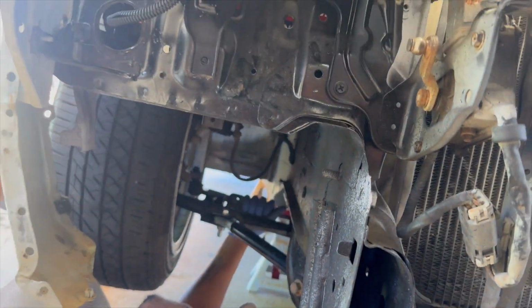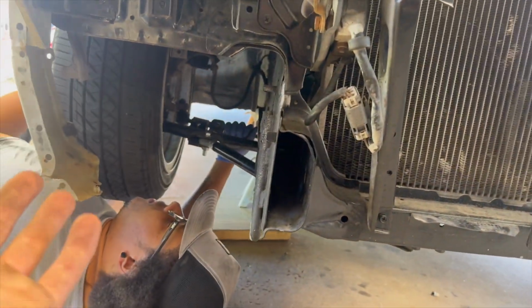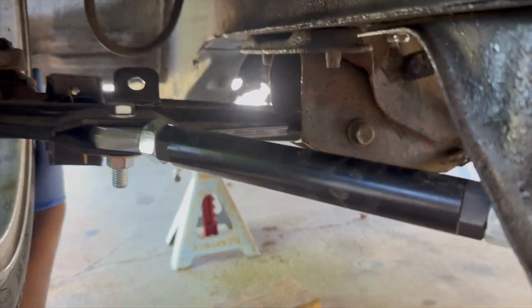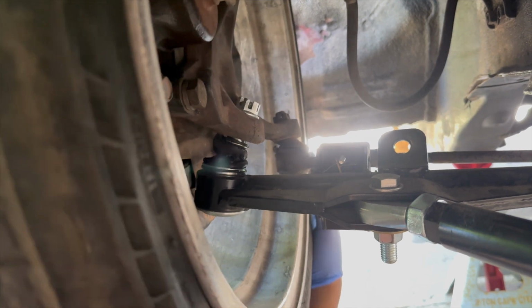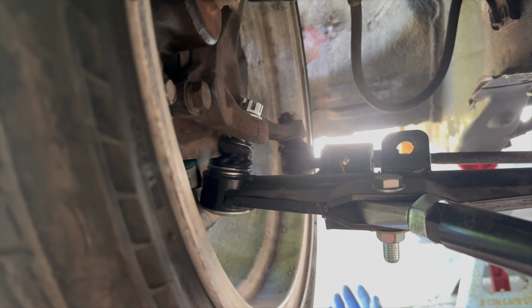So we took this thing on a drive. I have bolt checked everything. I've been over this whole car a bunch of times, right? But of course the previous owner decided to buy these nice, cheap, no-name control arms. And look at this, we were driving this like this. Dude, that's not bolted in. That thing is about to fall out. And I'm pretty sure I even tightened that. So we're just gonna tighten it again. I'm about to weld that on there.